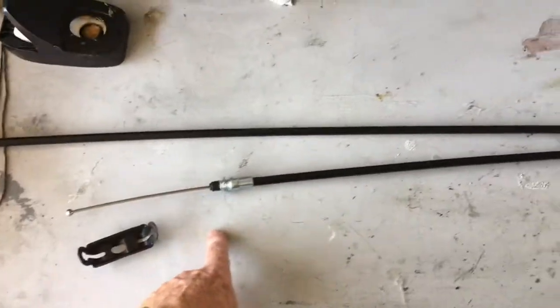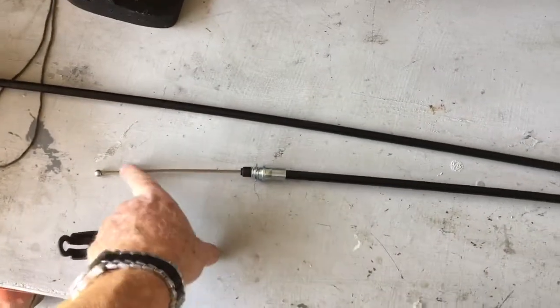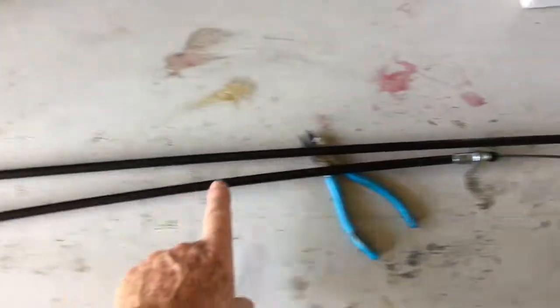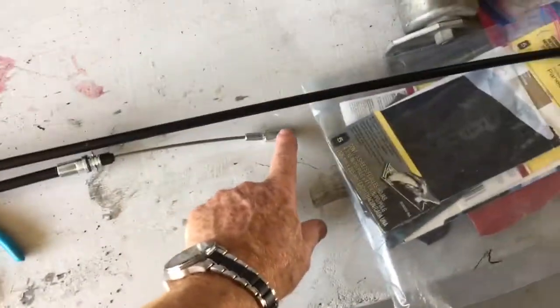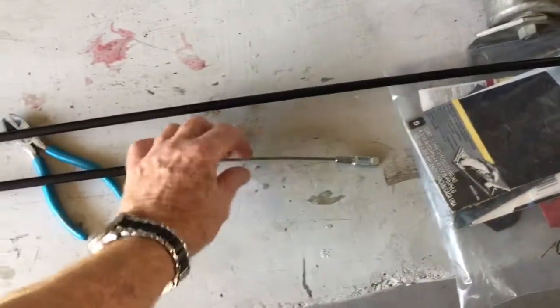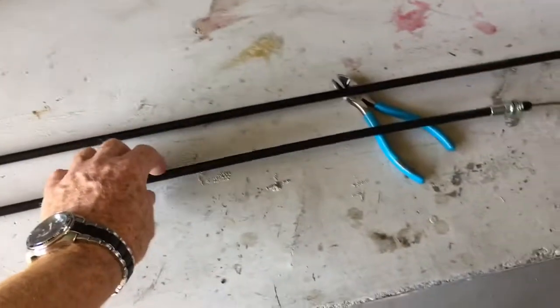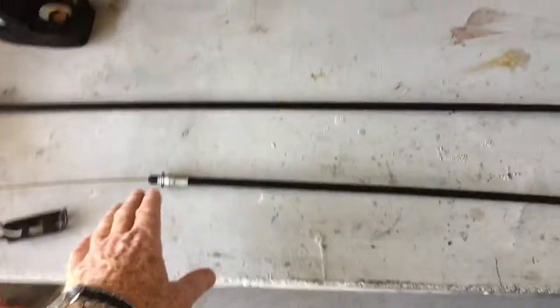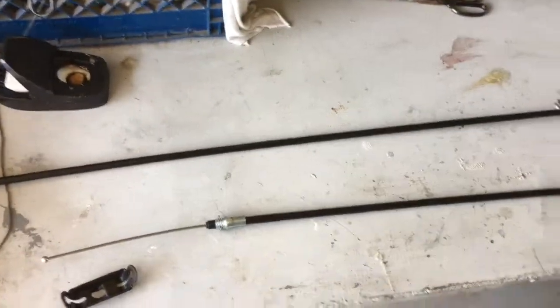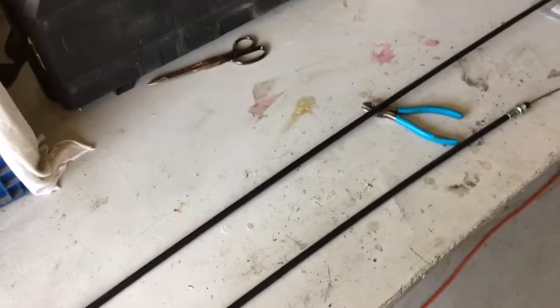What Control Cables does is they send you a diagram and you specify the lengths — they want to know the lengths from here to there, from here to here, and this length here. The only length they really know based on bare brakes is this length here, which I think is 3.75 inches. I had to do a little bit of guessing on the total length. The old cables were most likely not long enough because you have a different bend going to these brakes, so you're going to have to add inches — I think I added between three and five inches.